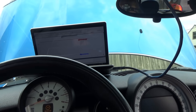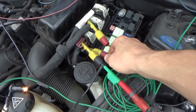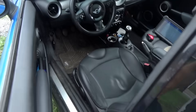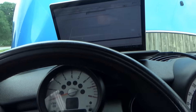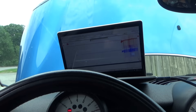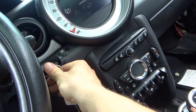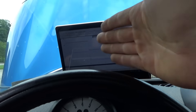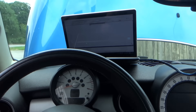Crank — no start, no power. Very interesting. So I think we have to send power directly to the ignition coils, not the DME power input pin. Instead of going there, we're going to go directly to the green wire. The ignition coils should have power — yes they sure do. It starts and runs. Shut it down, take the key out, and the DME goes to sleep and the coils lose power. Perfect — power dropped out, we're good.